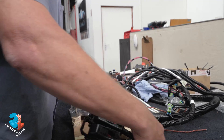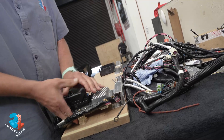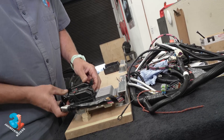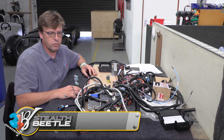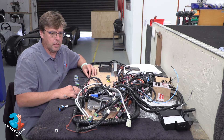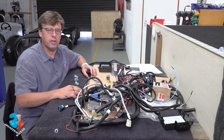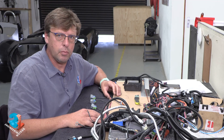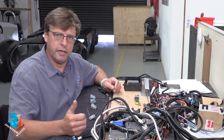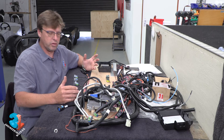While Jean has been busy sorting out the mechanical complications, Pierre has been getting to grips with the engine management side. Whilst the engine management for the Chevy crate engine is considerably easier than the Audi with its two turbos, there are still some considerable complications to overcome. The one biggest encumbrance is that in the Chevy, the firewall of the engine sits behind the engine — in other words between the engine and the gearbox. Whereas in our mid-mounted application, the firewall is ahead of the engine. Chevy designs these looms specifically for the firewall to be behind the engine, so we have to strip the loom down to its basic components and reshuffle a couple of things.